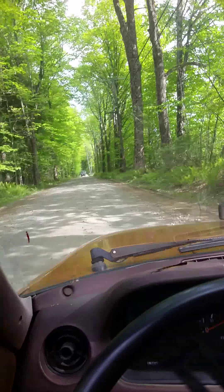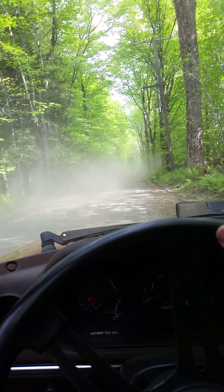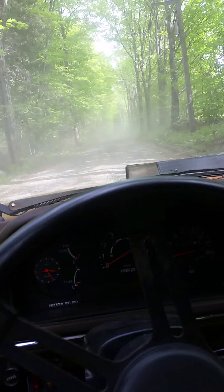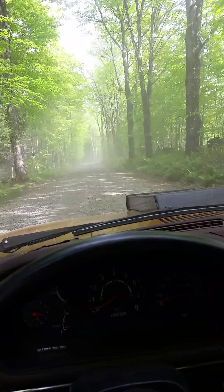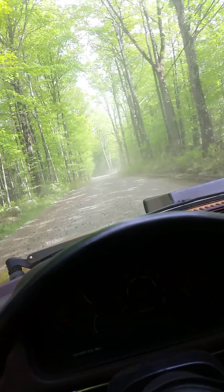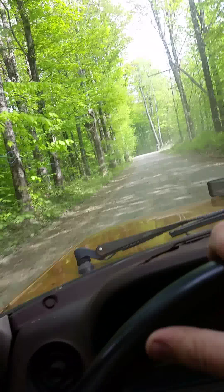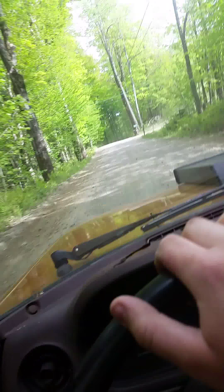I can wait for UPS. Nice and dusty. Go to about half throttle. I hear it popping already — already fouled the plugs out just being too much of a bitch going down the driveway with it. Need smaller jets.